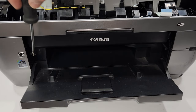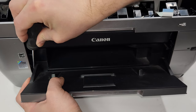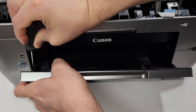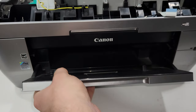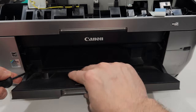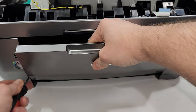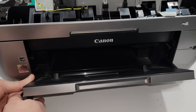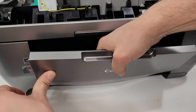Now for this paper output tray, we're just going to put a flathead screwdriver there and push to the left. That will allow us to remove one side. You can try either the left or right side — they're similar build, so whatever is easier. Just letting you know it's not that simple with this one; it's probably easier when we remove the sides.